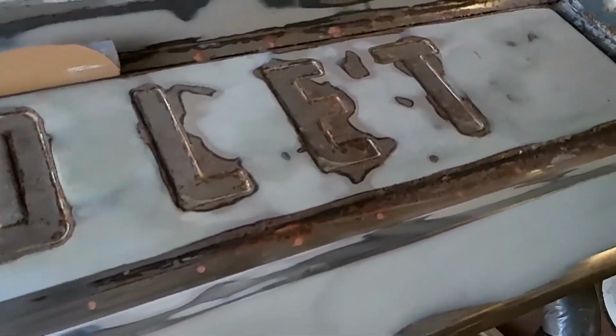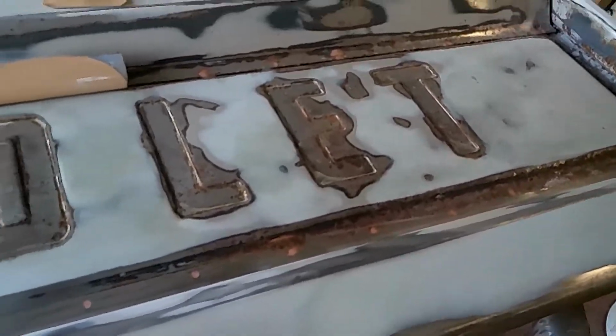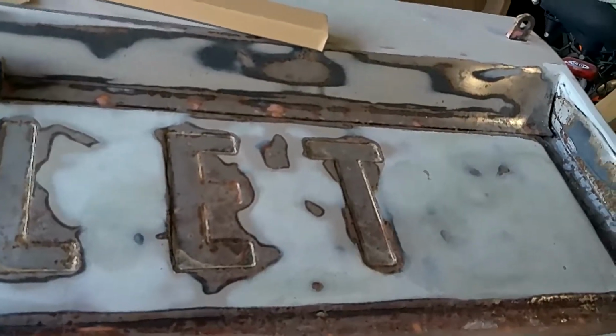And what I'm going to be doing is here on the seam, on both ends, once I get it cleaned up really good, and then like over here, on these corners, where there's an opening in the seam, where both the skins and the framing and all that meet, I'm gonna go ahead and fill that in. I'm gonna smooth it all out. I don't want no seams or anything, but first I gotta clean all this rust off of there again, because I was a dipshit and left it outside and it rained on us.